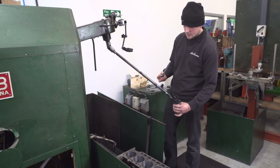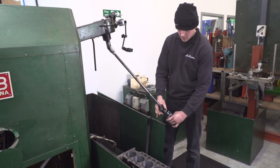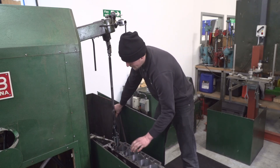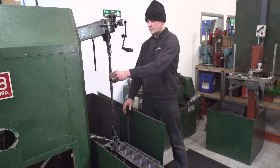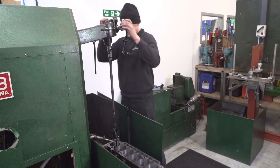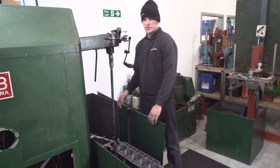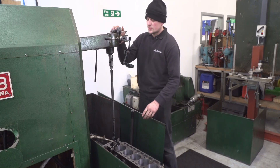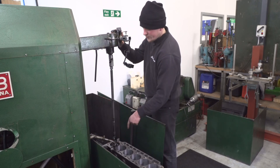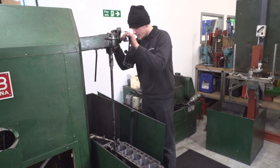With all our stones attached into the head, we've got our adjuster that slots in at the top, and we can adjust them out to match the size of the bore. We're going to bring our block down below and get it as in line as we can with the axis of the head. The first step is to bring this down a little and expand the stones. Now the last block on this machine was an S54, which is obviously slightly different to an M30, so we need to reset our stops. This is pretty critical — if we don't, the machine's going to ram that honing stone right through the main line of the block, causing a horrendous amount of damage, likely knacking the stones and the block.